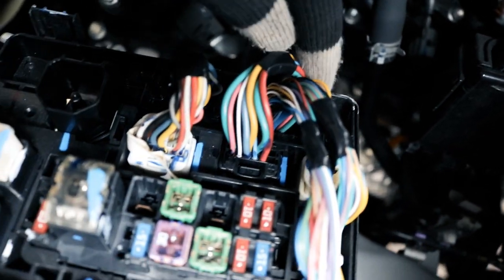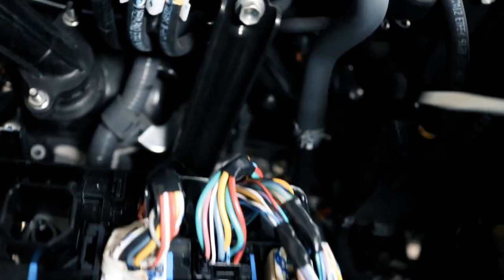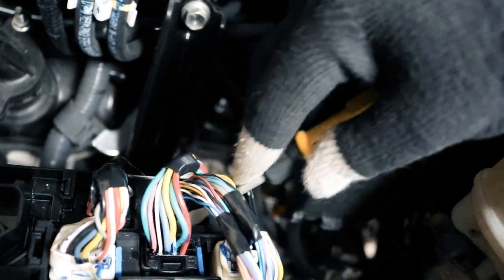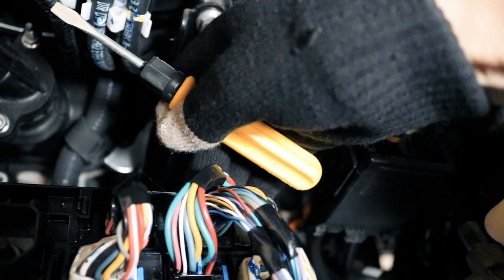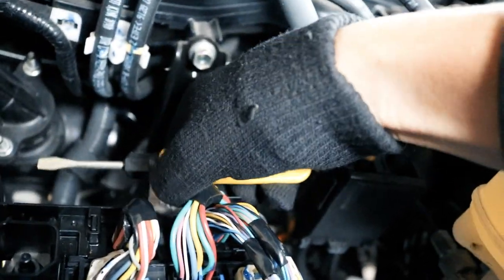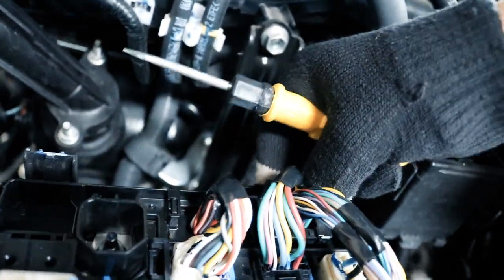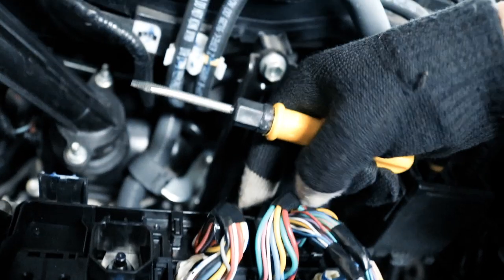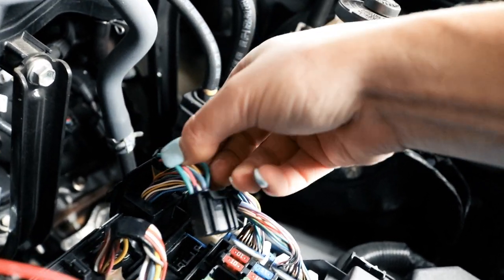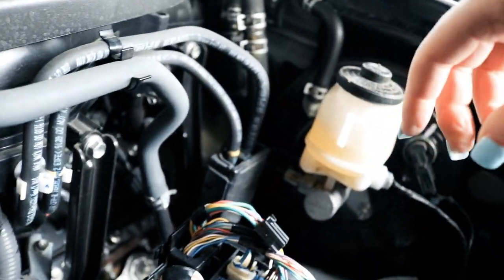This is the wire bundle we're going to route the wire through. This is hard to show, but there is a clip right here that you have to pull toward yourself, and then the back should start to come up. This is a little bit easier for me because I already did this, but you have to work at it a little bit. This clip should start to pull up — I pulled it up enough so there's a nice gap. You don't have to remove this other fuse; I just wanted to get it out of the way so you can see easier.